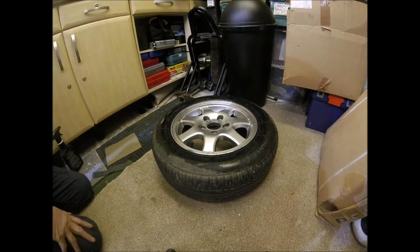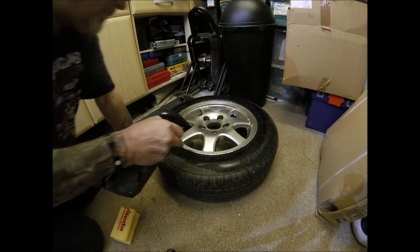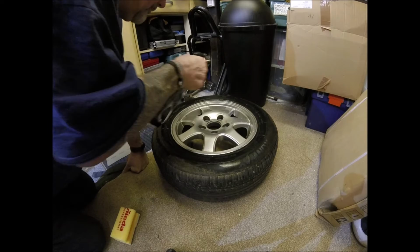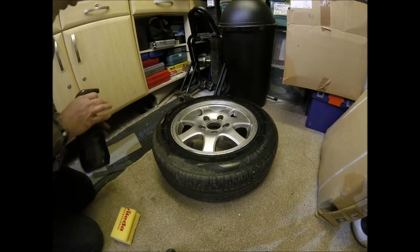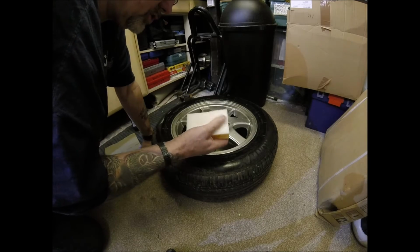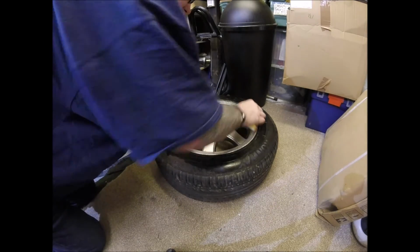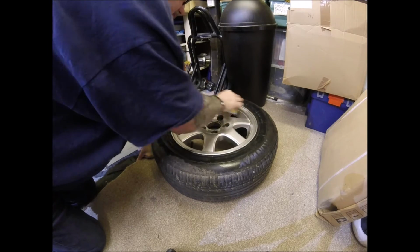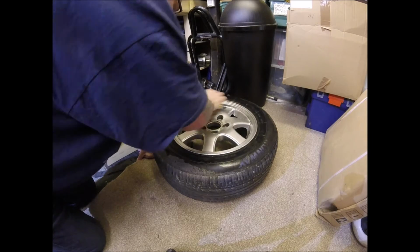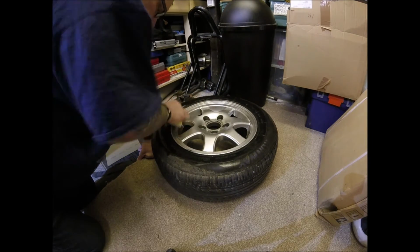So that's, we're getting there slowly. Always keep it really wet. That'll help stop deep gouges and scratches. I'm using a Scotch-Brite type, which will key up the paint underneath. All this rubbish about rubbing it all the way back down to the metal, and then etch primer and primer, it's a load of old bollocks really.